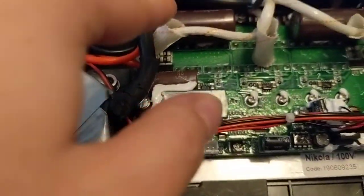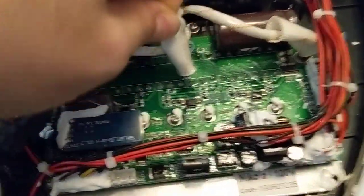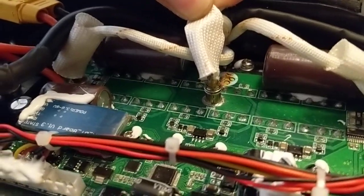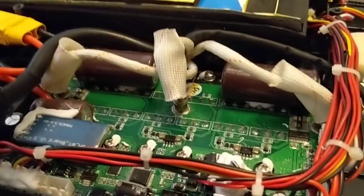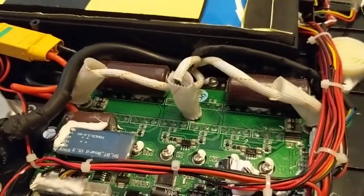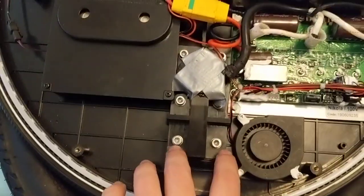Then you're going to want to unplug the three motor phase wires. They're just in these big connectors — like a big solid cylinder stuck in there. You're going to pull those out carefully. You can use pliers, but if you are, be very careful not to short anything on the board in case there is any residual capacitance, and also watch out for electrostatic discharge from your body or the tool. You're going to unplug those on both sides of the wheel, so on the other side you'll also need to remove those six screws.